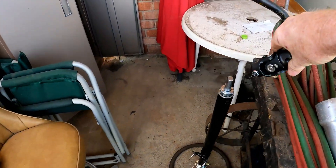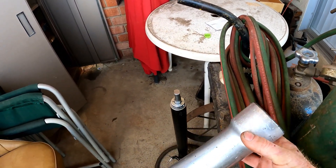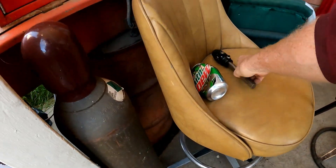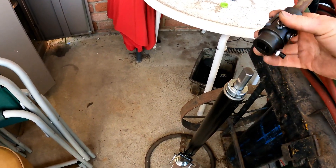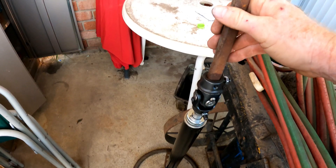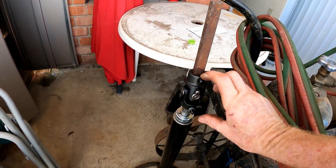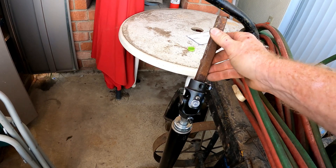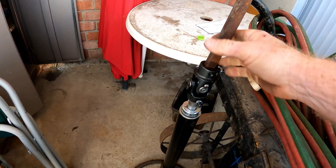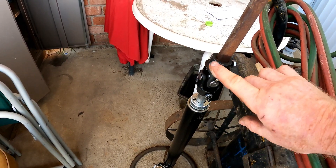This will slide right over that, but here's what I think I'm going to go with — a sleeve. It's so short coming out of that column that I can't have this stick out too far outside the firewall, because this is the only length room I have. The shorter it gets, the steeper this angle is going to get and they're going to bind.